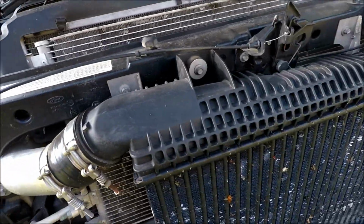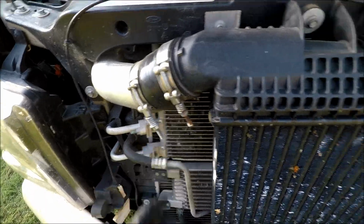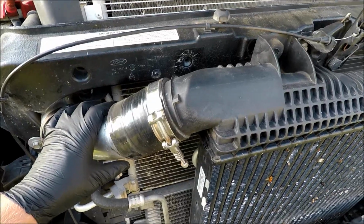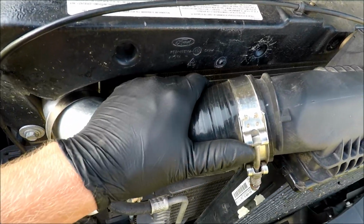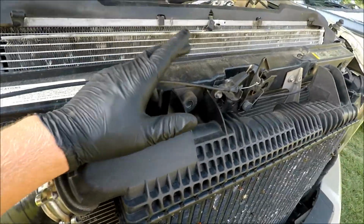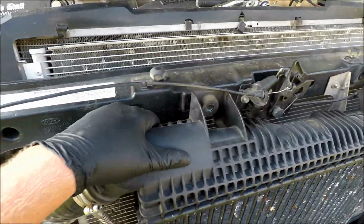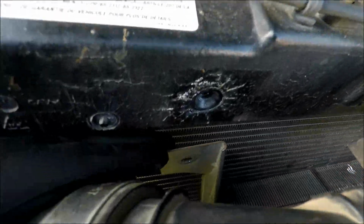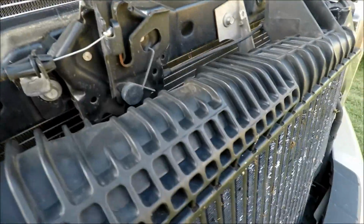First thing we need to do is take these clamps off, right here and on the bottom. Get those off real quick. Okay, so I'll try taking this clamp off. It's not moving, but in reality, you take the bolts out, which are 10 millimeter, and you scoot it back far enough to the gap, and take this next cooler off, more 10 millimeters.